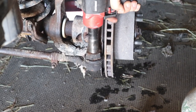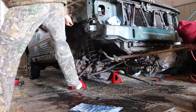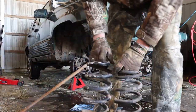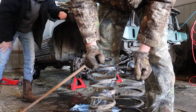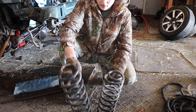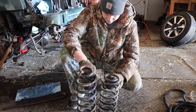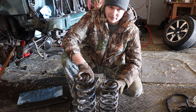Here's one that I've been working on right now. I don't know how easy this is going to go back in, but this is supposed to give it like two inches of lift. Here's one that just came out, and here's an F-350 coil off of a 2013 King Ranch — basically what we're going to try. We're going to try to put this coil up under the front and hopefully it'll give it around two inches of lift, which would be just big enough to fit like 33s under it. It's going to be fun.